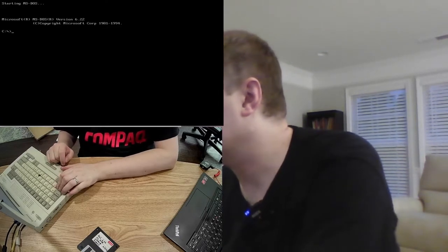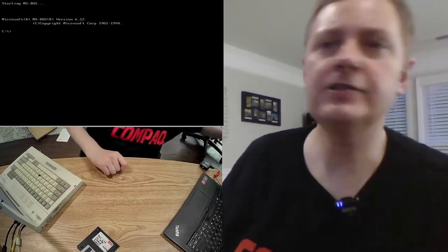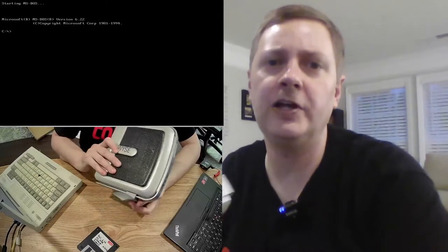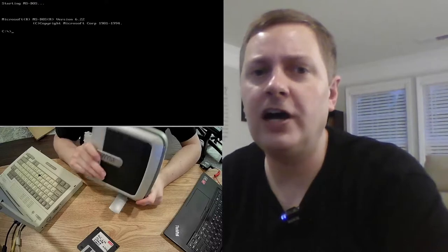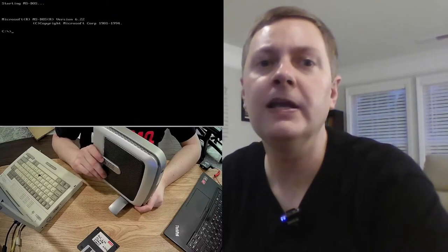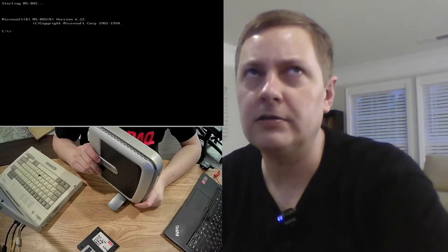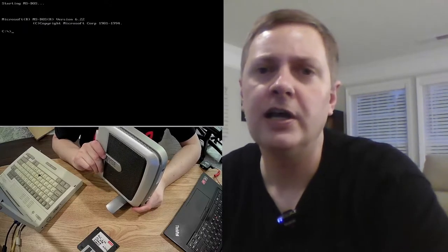So Jutara says, I have an old Wyse terminal and have no idea what to do with it. So here's what you can do. If it's a VX0 like this one, you could definitely load Windows 98 on it, with the one caveat that these come with 128 megabyte DOMs, or disk on module chips. So that's kind of anemic. But I bought a 16 gigabyte one that I put in here, and now I have a little more storage.